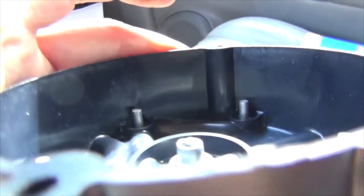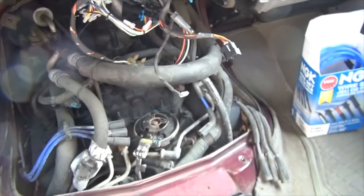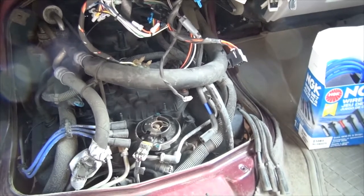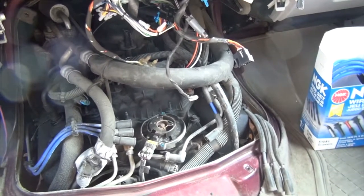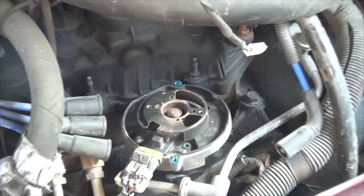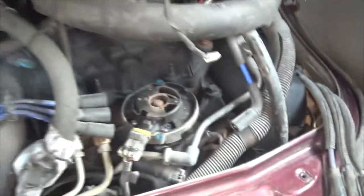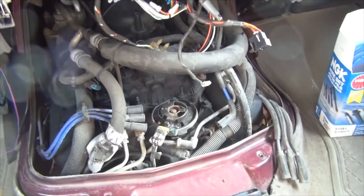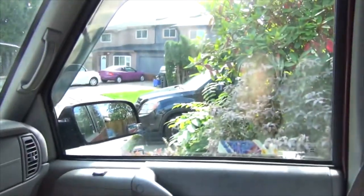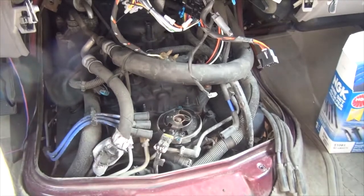Back in the day these used to be brass — no longer brass, and that's why you may feel like you're changing your distributor cap every two years. Under heavy use — think maybe 30,000 kilometers with a lot of hard driving — that's pretty much the interval for me. This cap here is actually over three years old, but the vehicle has probably only gone about 20,000 kilometers in three years because I have two other vehicles and was doing less towing and hauling.